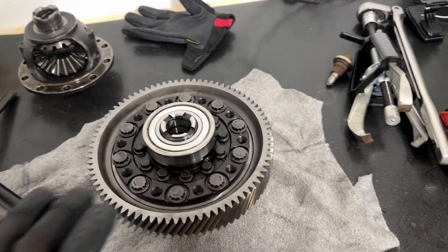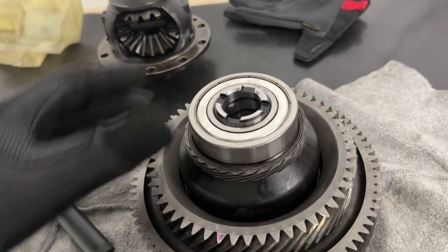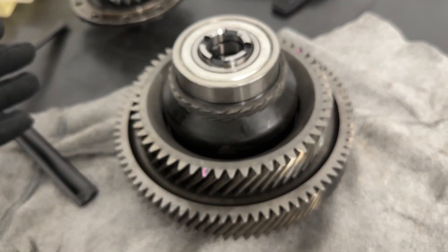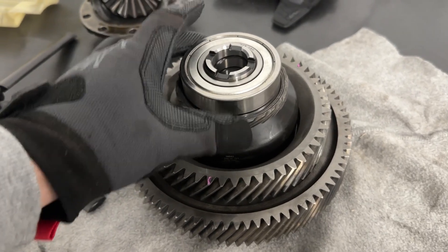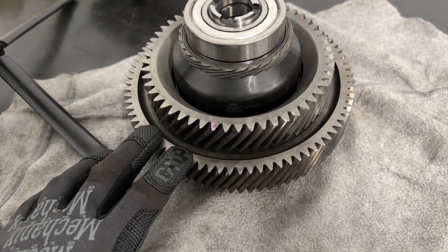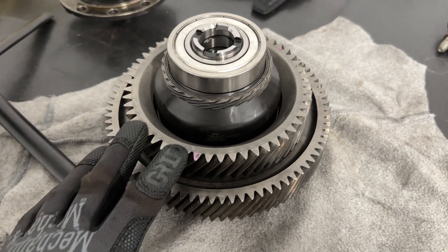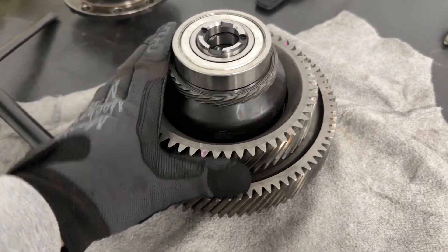For this diff specifically, which still uses a vehicle speed sensor on the differential, you'll need to harvest this bearing and get the ring gear off as well. Again, heat the ring gear up to 200 degrees using the toaster oven — it's the main tool to assemble a differential — and it just falls right on. Make sure they're fully seated so you don't have to hammer them down. The transfer driven gear and ring gear are a pretty tight fit but I heated those up to about 180 degrees and they slid right on.